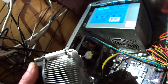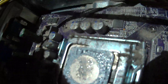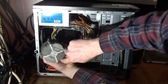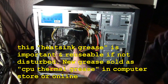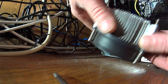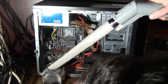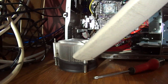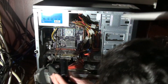Now what we have done is taken off the fan and the heat sink as an assembly. There is some grease on the back of the heat sink that attaches it to the CPU right back there, and we are going to be as careful as we can not to disturb that grease because we are going to be reusing it. We are going to try to vacuum out all that dust without getting it on the grease. Like I said, you may not have to take this fan off — you may be able to get in there with your narrow crevice tool and get all the dirt without pulling the fan off.